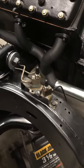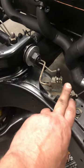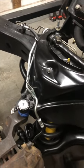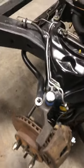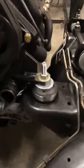I've got the original brakes here. What I like to do is get some AN3 or dash-3 AN hose running in here up to my master cylinder, which I'll eventually install. I've got the original calipers and rotors. I did replace the brake hoses up front.